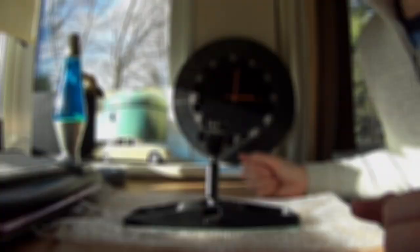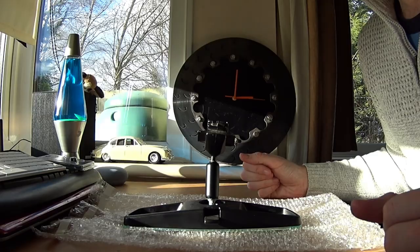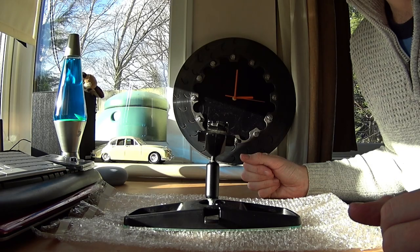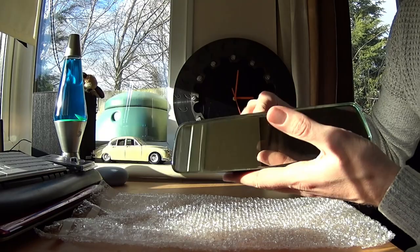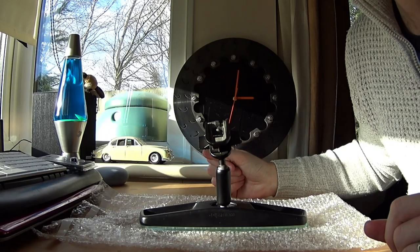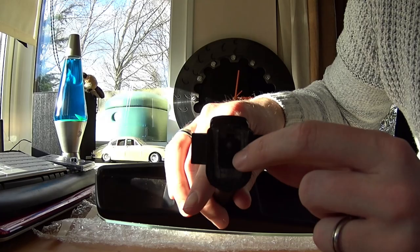And let's transfer to removing the mirror. Now we are indoors. Here's the rearview mirror which I removed from my R3, and it's the GT86 mirror which I've had before. However, there's a bit of discolouration around the edge, a few scratches — I bought this second hand very cheap. Just a close-up of the mount there. You can see you need to push this tab upwards — it's quite stiff, but just a little flathead screwdriver or whatever through this hole will do the job.